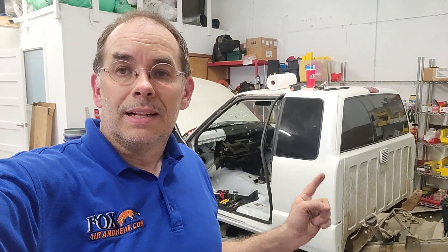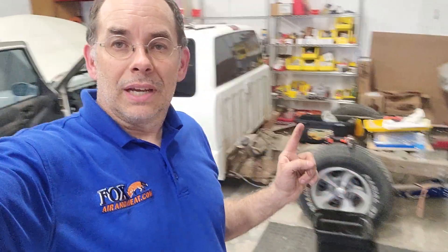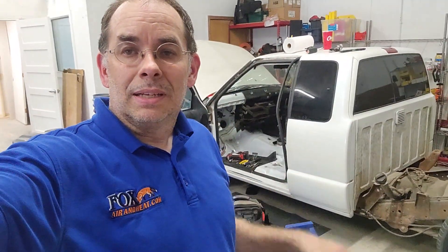This is a 1998 Chevy S10 and we're gonna put a small block Ford in it with twin turbos, and it's gonna have fuel injection. We're gonna put a small tire on the back — we're doing like 10 and a half by 28, so it's a true 10.5-inch tire. We're gonna do a back half and leave the factory cab and frame, and probably use the stock front suspension.